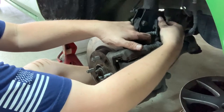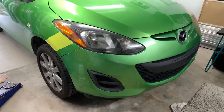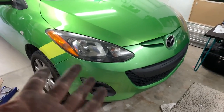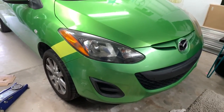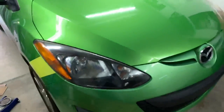Can't forget the brake line. It's all back together — holy crap! With the car fully assembled and back on the ground, all that's left is an alignment. You're going to need one after this job. Whether you do it or a shop does it, if you undo suspension and steering components, you're going to need an alignment. I do my own string alignments right here in the garage with great success, so that's one less cost to worry about. That's another DIY project I want to show people, but that'll have to wait for another video.